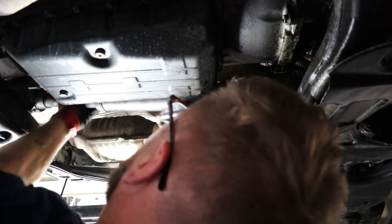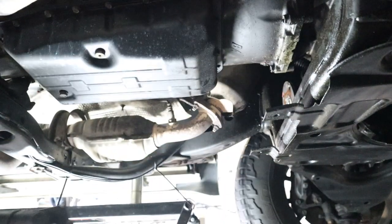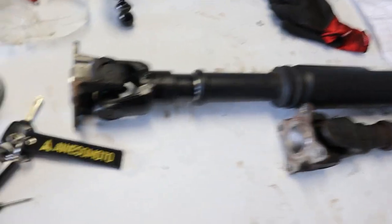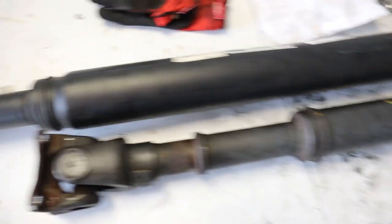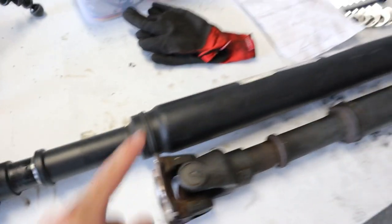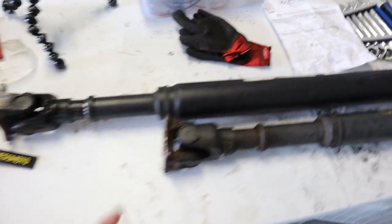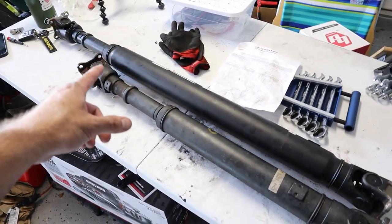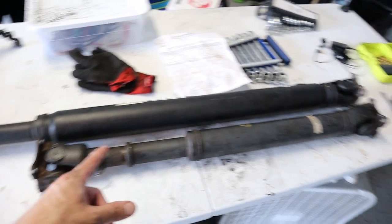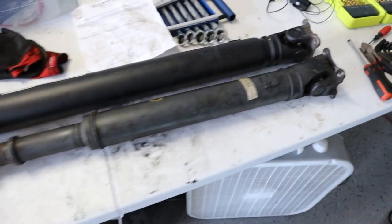The drive shaft is loose — pivot it out and slowly work our way out. We've got an obvious size difference between the new drive shaft and the old one. Unfortunately, I misread the part number and ordered the rear drive shaft instead of the front. Good news: I can totally use this rear drive shaft since the current rear one has almost 190,000 miles. I'll go order the correct front drive shaft and put the part numbers in the description.